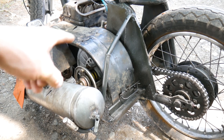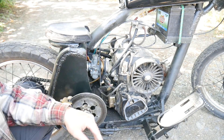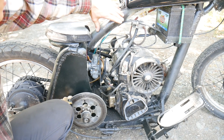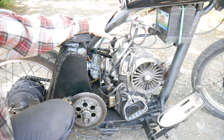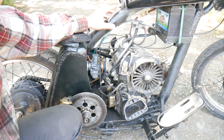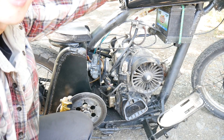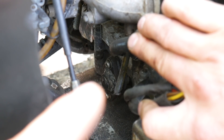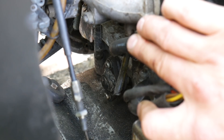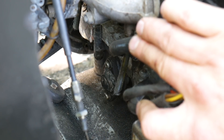Today we're going to find out whether or not it really does make that big of a difference. On the other side, you'll notice that the oil reservoir for the oil injector is gone — I took that out. You guys suggested that as well, just in case it's not working. We're running 40 to 1, probably a little bit less, maybe 35 to 1, just to try it out. That's where the oil pump was — I made a little flange for it, plugged it in there, put some gasket maker on there, and plugged up the tubes going to each cylinder.